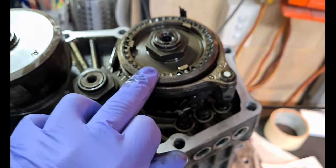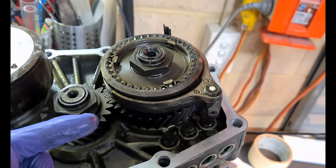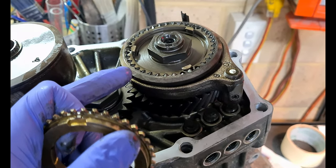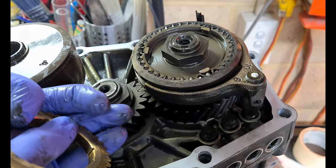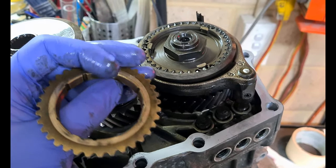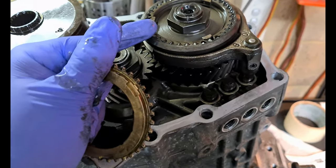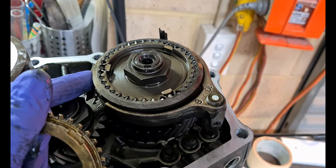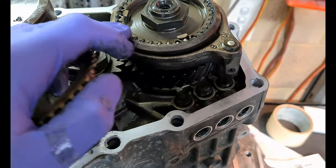There's always a question asked of whether you can just flip the sleeve the other way to put the fresh teeth on the fifth gear side. In theory I guess yes, but the Mitsubishi training manual for these transmissions says specifically not to do that if I remember correctly. Some people on Facebook or forum threads have said they've done it and haven't had any issues, so if it works for you, cool. I've done the GSR transmission in my Australian-built GSR — I didn't flip it and the fifth gear side is still worn, but with a fresh synchro it's just fine with no notching at all.